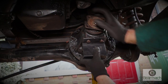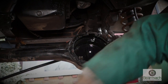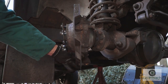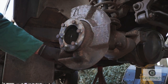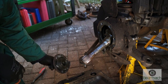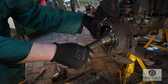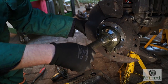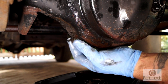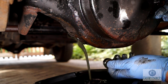In this tutorial, we're going to remove the pinion housing casing with the final drive assembly and refit another one. Compared to the rear axle, the front axle is a lot more work — you have to strip out the CV joint and the half shafts out of the swivel housing, so this is more involved. The first thing we need to do is remove the oil, and then we can get on taking this and putting it on axle stands and stripping out the components.